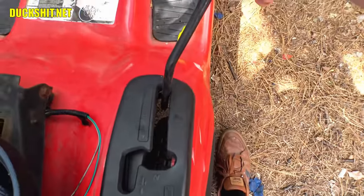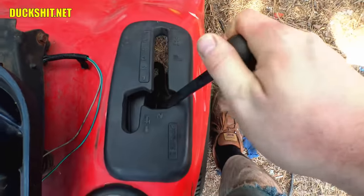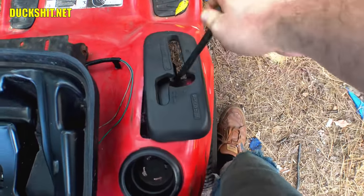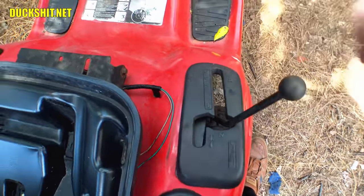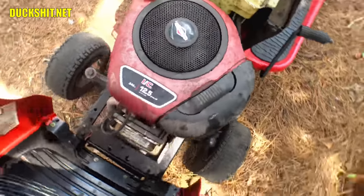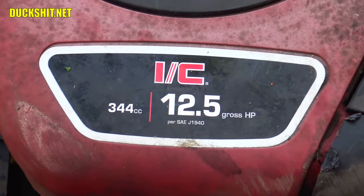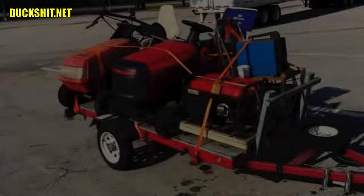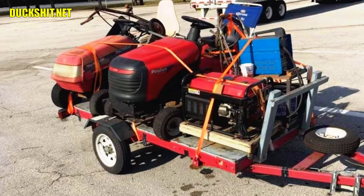The third chassis has a very nice 6-speed gearbox with actual gears and not some silly pulley cluster — much better than the forward and reverse only gearbox on the mow cart now. I think this will be retained. Looking at goofy things I found on it, I know Dad was having problems: there was a chain tied around the carburetor linkage with the other end tied around the steering column. He was likely pulling that chain to keep the RPMs up, so it probably had a carburetor or governor issue. I also found a 7-year-old car battery out in Dad's backyard, brought it back as ballast on the rear of the trailer because the tongue weight was just too heavy.